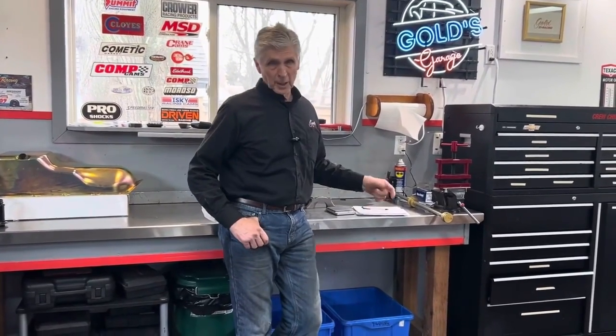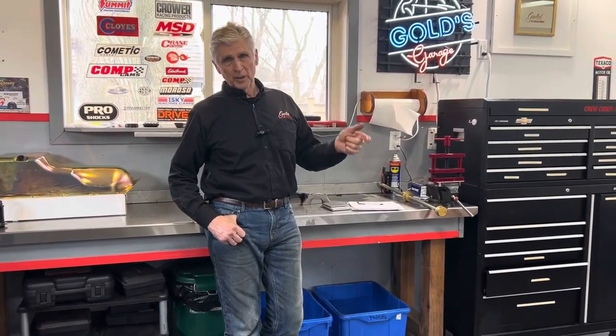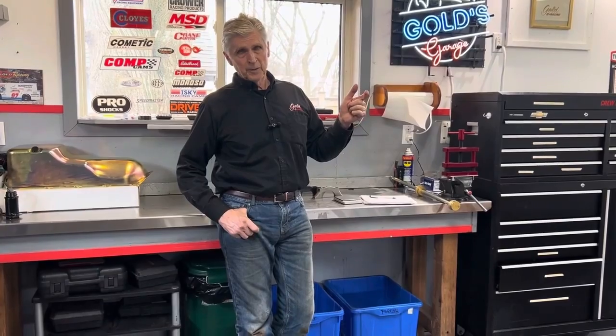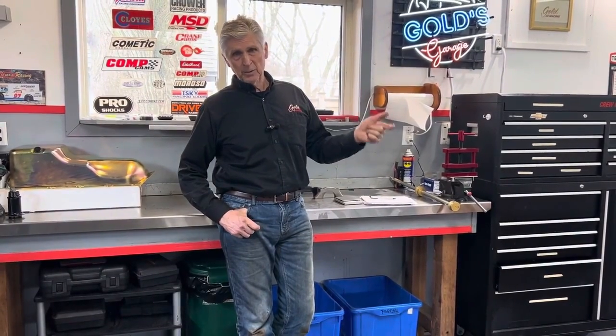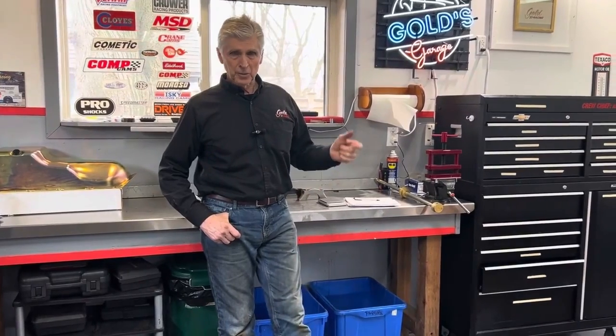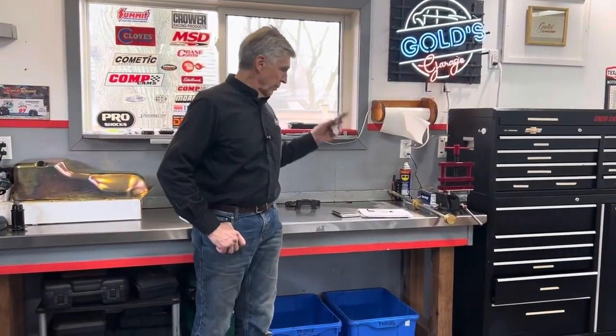The next one is high RPM, of course. RPM can damage engines. We're limiting the RPM to 6,000. I'm quite confident. I know Bill was telling me he builds lots of drag racing engines. He built 406s for guys that are running them 8,000 RPM on the drag strip without any issue. So at 6,000, we're going to be pretty safe. So I'm feeling pretty good about that.